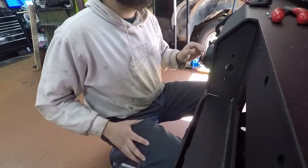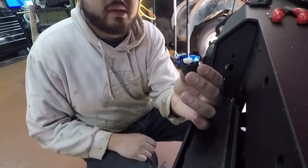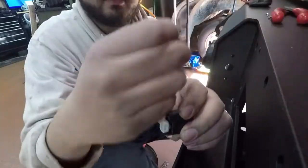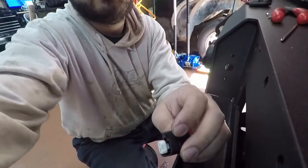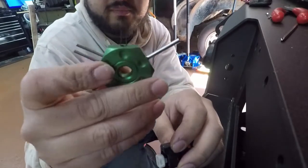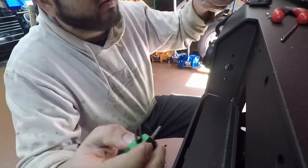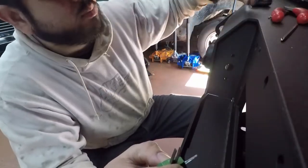Hey guys, so here's what I've done so far. I pulled out my license plate connector. All you do is stick a small screwdriver in there, something like this, and pry it forward, and then you're going to need this type of tool. I really don't know what it's called. It's almost like a multi-purpose electrical tool, I guess you could say. You can probably get this off of Amazon. You stick it in here, compress these square connectors, and then just pull them out from the back end.